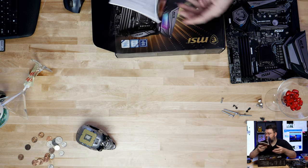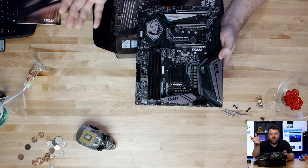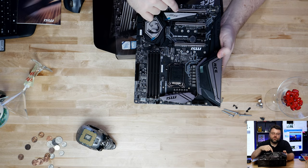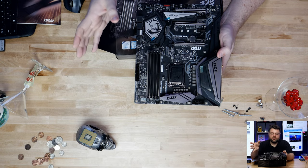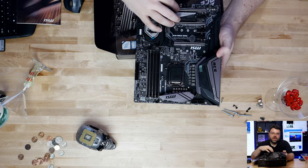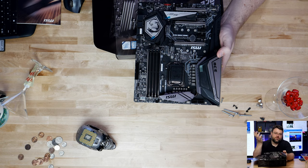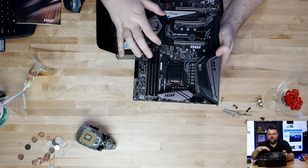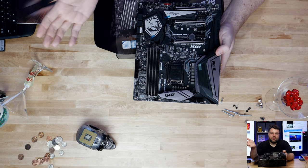So this is pretty cool. According to the manual, and I've got to test this to be sure, this motherboard will run this slot in x8 and this slot in x8, this one by nothing, or x8/x4/x4. So if you wanted to do M.2 RAID, you could use one M.2 off the chipset and one as a PCI Express add-in card, and you would not bottleneck, but your graphics card will be running at x8, and then you've got x4 here for another peripheral. If you wanted to run SLI and M.2 RAID, you have to use two M.2 slots through the chipset, which doesn't actually really benefit you.